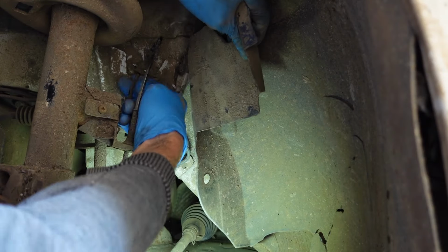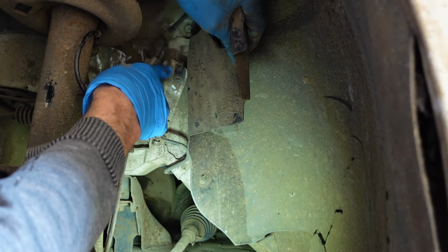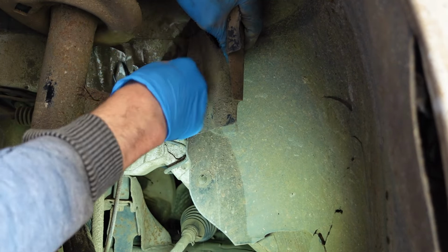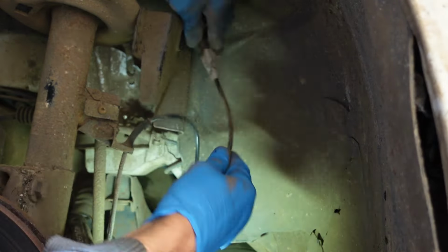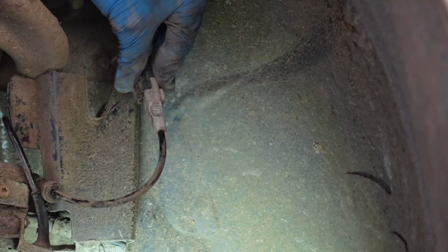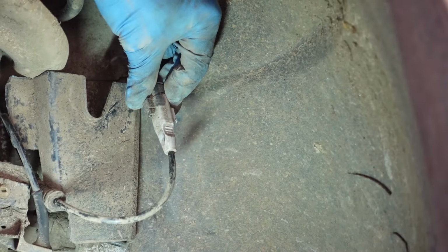So it's connected onto the body on this little tab, and then that should be clipped onto there. Interestingly enough, it's broken off. It should just slide off. So there's a little tab here, push that in with a flat blade screwdriver, slide that up out of the way, and then this, if we zoom in, nice simple tab. So just showing you up close there, it's just connected on here at the back, and then here we just lift that front tab up and pull the two parts apart.